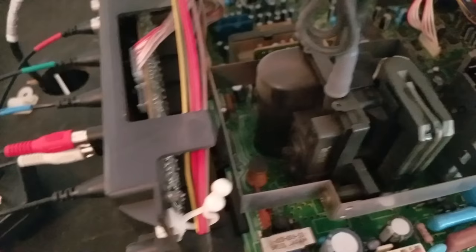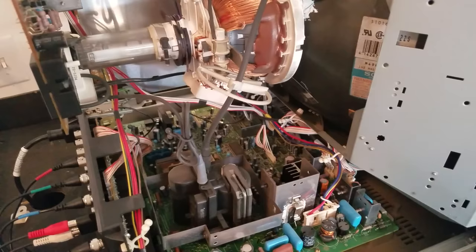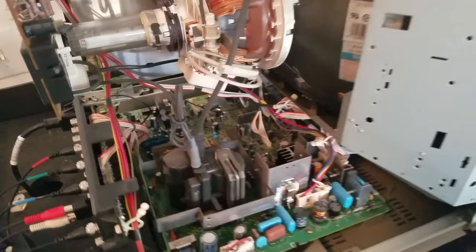I have to turn that little knob with my finger just left or right — basically clockwise or counterclockwise — to make an adjustment. The monitor does have to be powered on to get this adjustment done right. Basically what I'm going to be doing behind the monitor is just turning that potentiometer and clearing up our focus. I'm going to move the camera back to the front so you can watch that. I've got my screen turned on here with my test suite. This is a good test so you can see throughout the entire screen how focused and sharp your picture is.